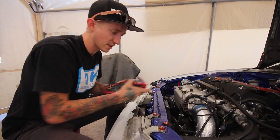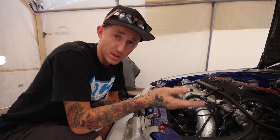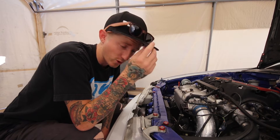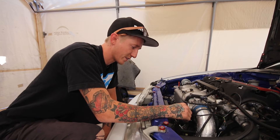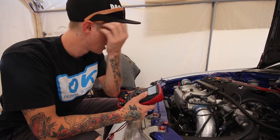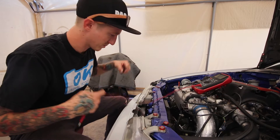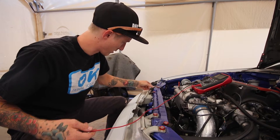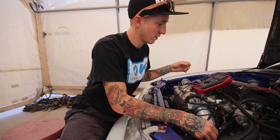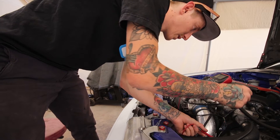This is the hall effect sensor — it's a magnetic design with no contact point, supposedly more accurate and longer lasting. According to the K-tuned forum, they've only had one failure to date as of like three or four years ago. Brian told me to back-probe it like I have now and just sweep the throttle to see if the voltage goes up smoothly or if there are any jumps. Right now we're reading about 0.53 volts.